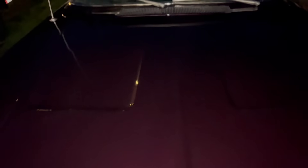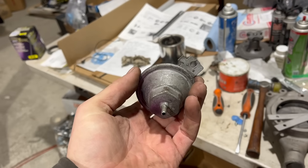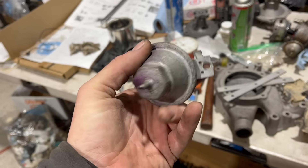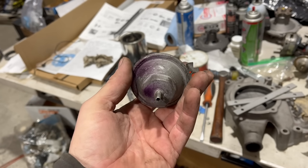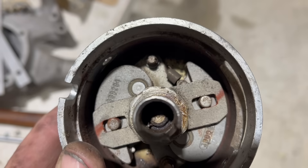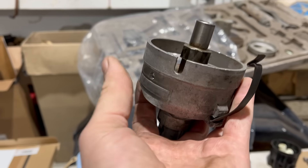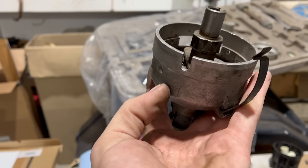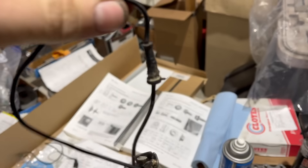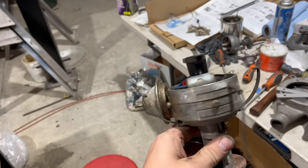This thing's basically fixed forever. A couple more thoughts on distributors before I leave you. There's some debate in automotive circles about whether your vacuum advance should be connected to manifold vacuum or ported vacuum, which is above the throttle blades, meaning it's not in play at idle. I'm going to do a whole video on working with that idea in the future. Just know that with these factory distributor setups, this needs to be run to ported advance or it's not going to work right. I stand corrected — there's one broken spring in there. This one I took out was definitely not an original; that deep cut is the same as is used on electronic distributors. The earlier points distributors used a different kind of wire in a smaller hole.